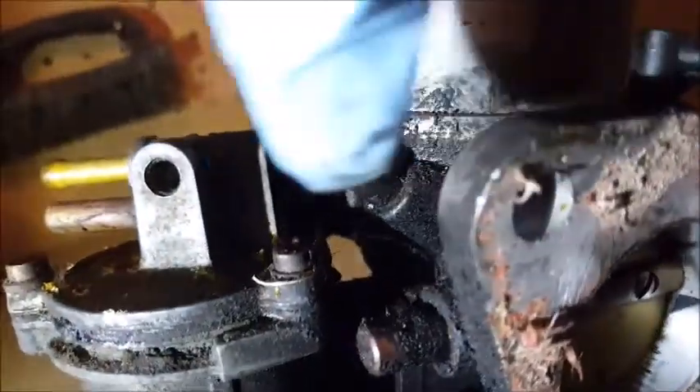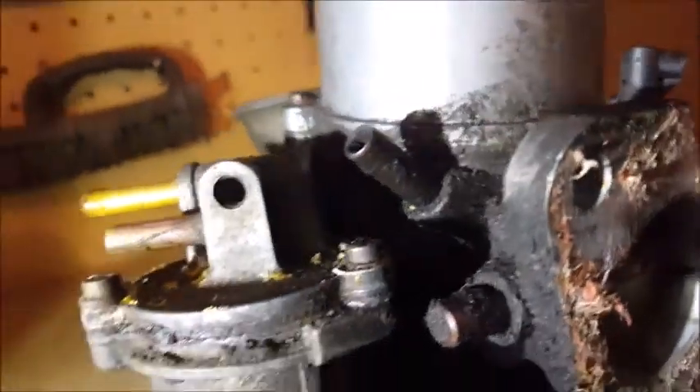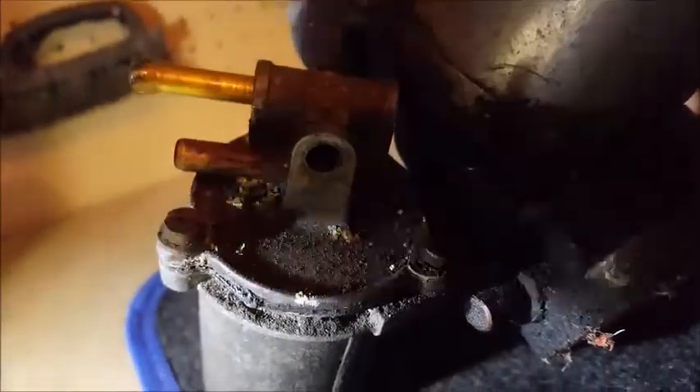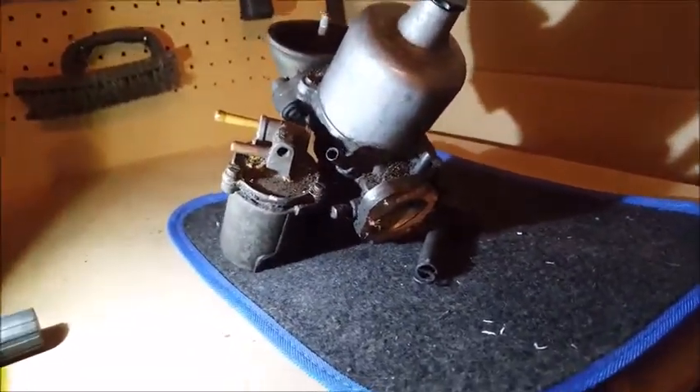The last hose to come off is the engine breather hose. I've got it attached here — you can see if you follow it back into the engine there. That's simply a jubilee clip fitting attached to this here. It's fairly simple to come off — just the same as the others, undo it and just pull it. Some of them might need a wee bit of elbow grease. If you feel them stuck, pull it at the same time as twisting in a motion and it just works its way loose. If you have to remember, it's been on there years, if not decades.